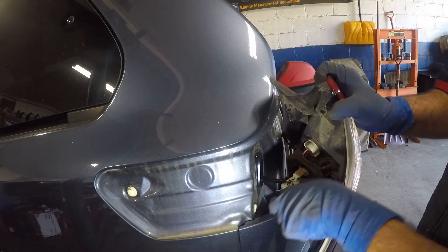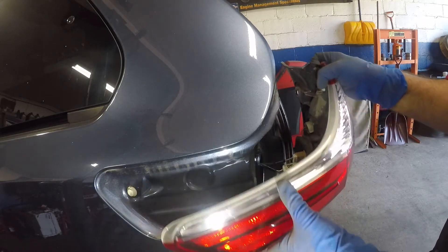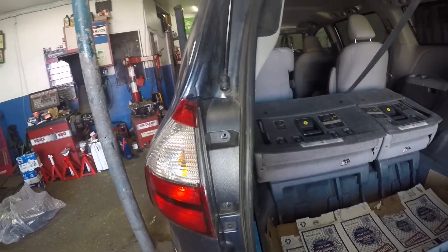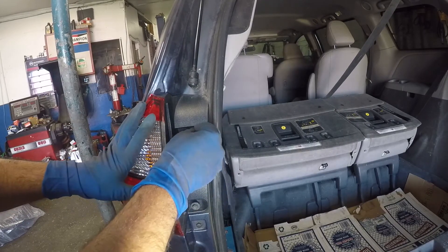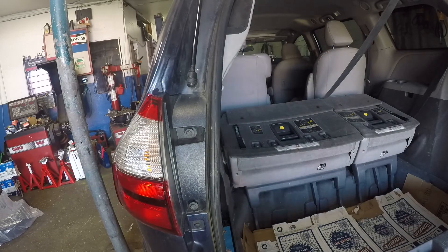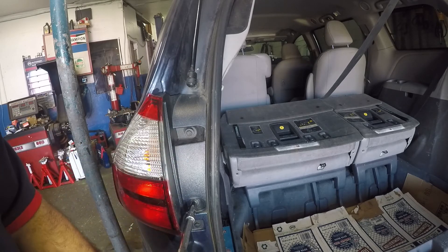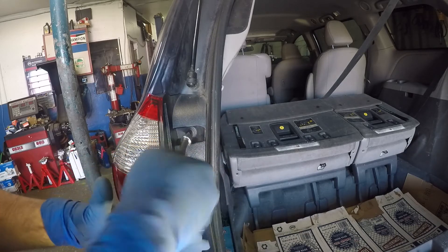To put it back, pay attention to this little guy right here — it's going to go in here, and the fork is going to go in there. Pretty much you just line up everything. Once you line up everything, you just hit it and it goes back to its spot. Make sure everything is nice and perfect. Come back around and put the number 10 bolt and the other number 10 in. Take your ratchet and simply just turn it. Don't go crazy tightening this — just a turn where it snugs in. This is plastic, you will break that plastic.